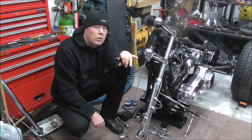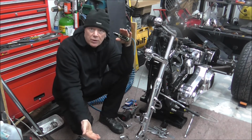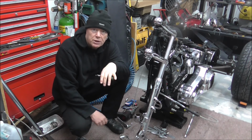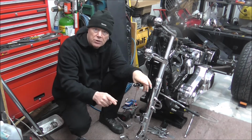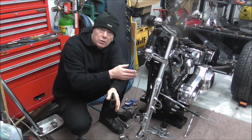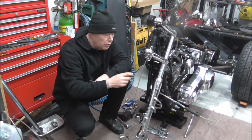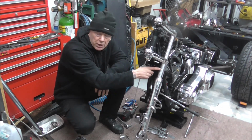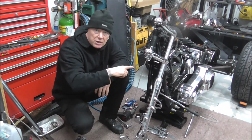So if you look at, for example, a 96 Softail stanchion for the length you want, and then look at a newer Softail, say, for argument's sake, 2001, the part number for the fork stanchions is exactly the same. So if you order a set for a 96 Softail, you're going to get the exact same pair as you would for the 2001. Obviously you've got to have the correct length. Say the length of the fork on your bike as standard is 22.5 inch, stanchion wise. You look through and find 41mm forks, 22.5 inch long, on their page. It'll give you the exact same part number. The forks are identical.